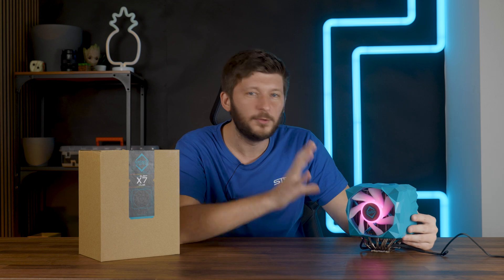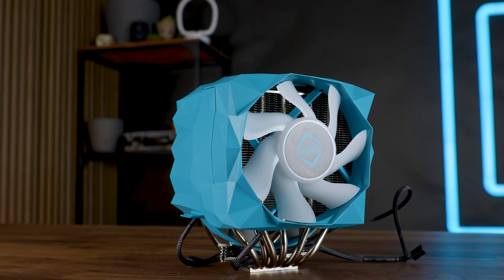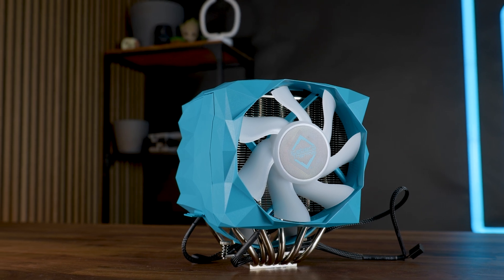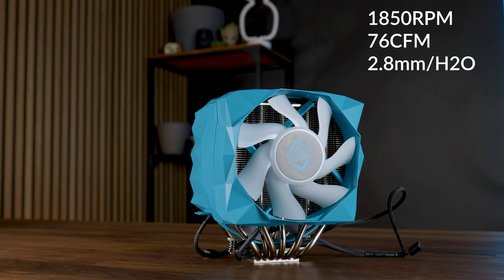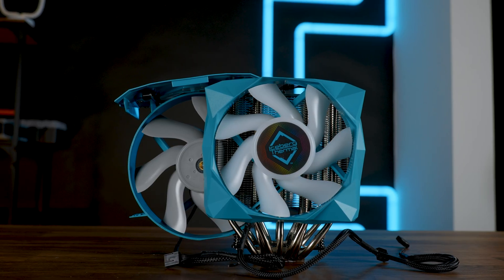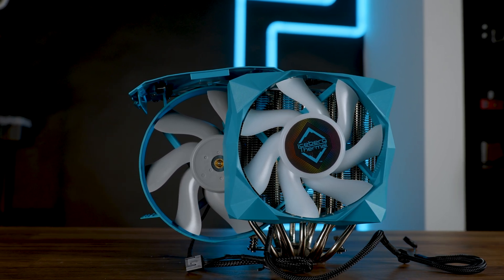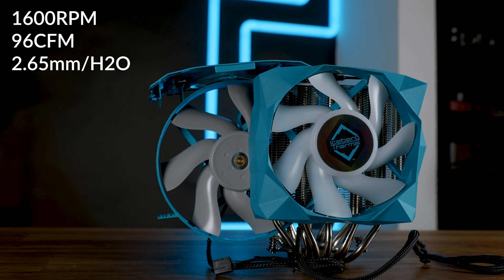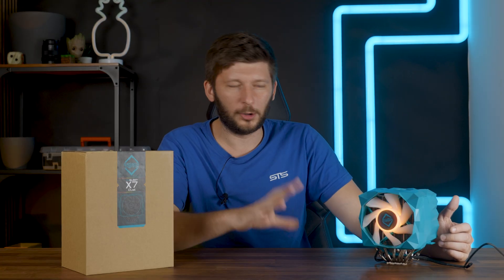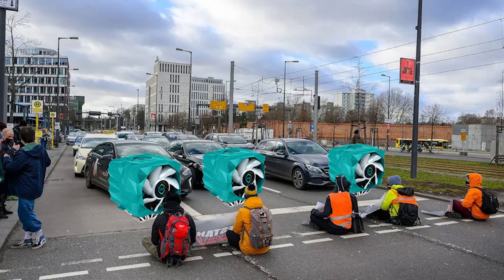Now let's take a closer look at this beautiful piece of polypropylene. In the front we have a 120mm fan, but unlike the monster that Iceberg Thermal offers, this one spins at up to 1815 RPM whilst pushing 76 CFM at 2.8mm of H2O. The 140mm fan, completely entrapped inside these well-designed and absolutely easy-to-remove sheets of sophisticated Coca-Cola bottles, spins at up to 1600 RPM with 96 CFM and 2.65mm of H2O. If you were to remove all of this plastic, we got three things: the most horrific experience ever, enough of that stuff to upset every politician in Europe, and somebody will glue himself to your driveway.